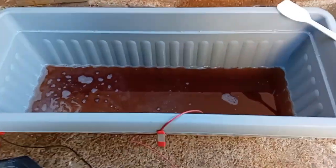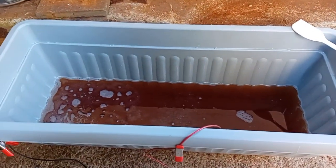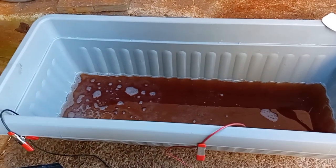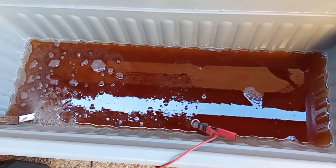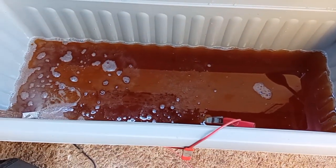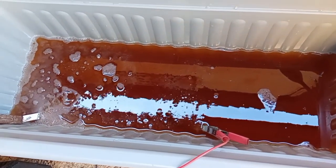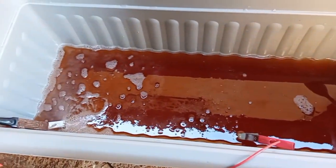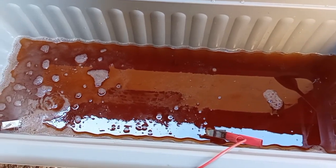They will be going in here. I went out this morning and bought the biggest container I could find that would fit the handlebars without having to completely fill it — around about 20 litres of electrolyte. This is a planter. In there is some distilled vinegar, not the kind with seasoning — just distilled white vinegar. And also some Himalayan pink rock salt. It was the only salt I could buy that didn't have any additives like anti-clumping agent. Unfortunately I think it's made the electrolyte go pink instead of blue, like it's supposed to.